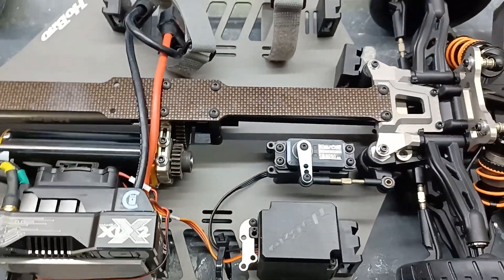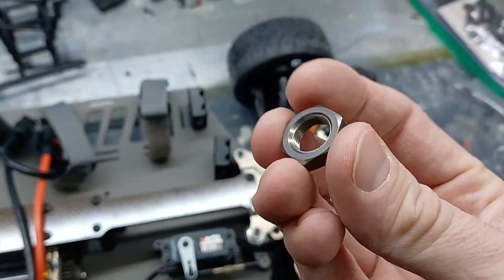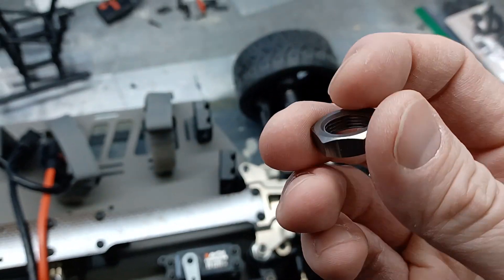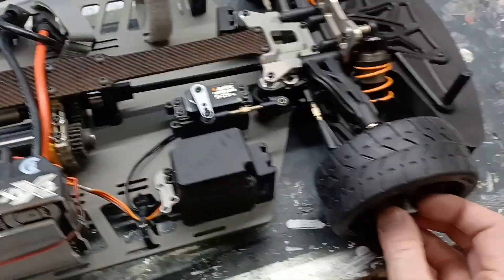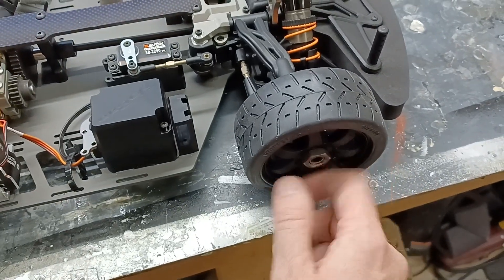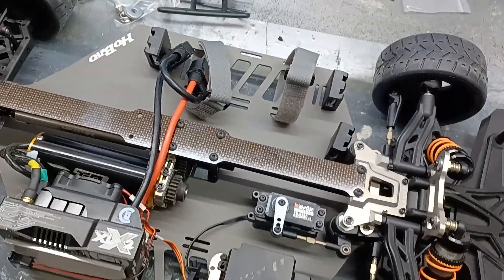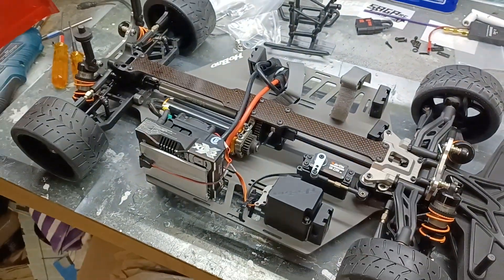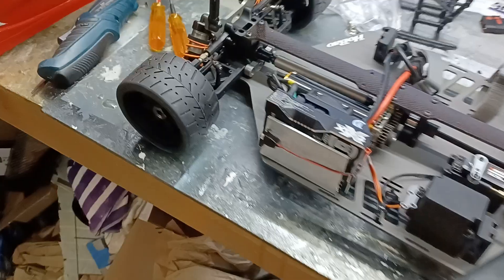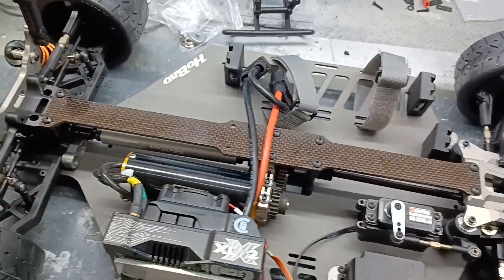Another thing — it's small and a cheap fix — but their hex nuts don't have the little cuts in them to stop them from loosening. These smooth wheel nuts will definitely back off at some point, and there's nothing worse than putting your thousand-dollar RC car down the road and having a wheel fly off and crash that thing really hard.